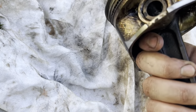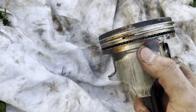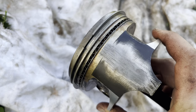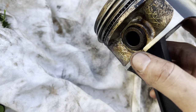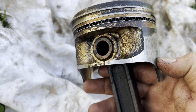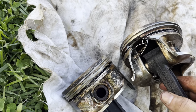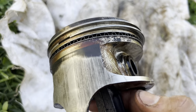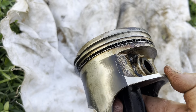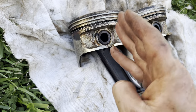I was looking at the other pistons and they look good — they have some wear. They definitely need to be replaced. If you didn't have the money, these would get you by for a while, but I definitely recommend replacing them. Even though a piston looks pretty decent, you need to really inspect it — because if you look close, you can see this whole piston is about to bust just like this one did. There's a crack here, crack here, crack here. So you're better off going ahead and replacing the pistons because these aren't any good.